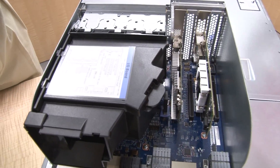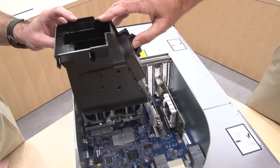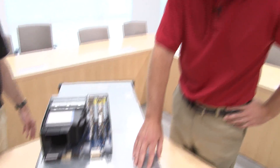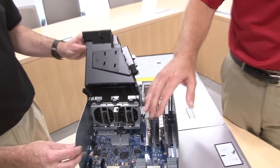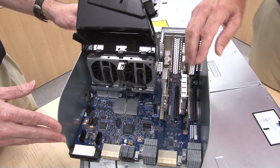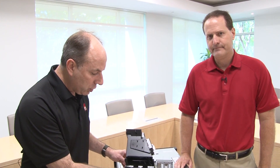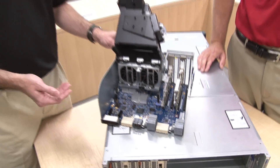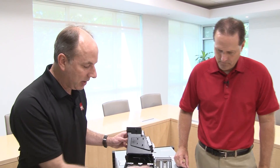The ML2 supports NCSI — a protocol that allows the management port to be shared, if you so desire. This is the air baffle. One of the reasons we have this air baffle is that it pulls cool air through the hard drives at the front of the server, lined up with the hard drives. The processors have their own fans sitting in front of them. This system board holds the firmware for the server, and the IMM — the Integrated Management Module — is on this system board as well. This is also where the USB hypervisor key is located; if you want to have VMware ESXi on a key, that's where it would go. This lifts up for easy access to those components.